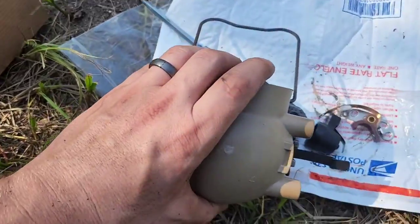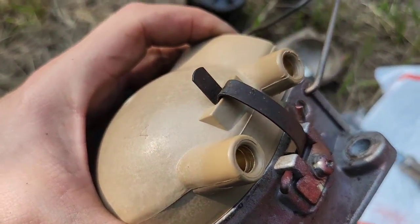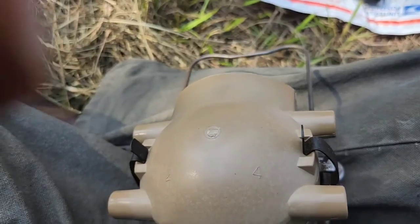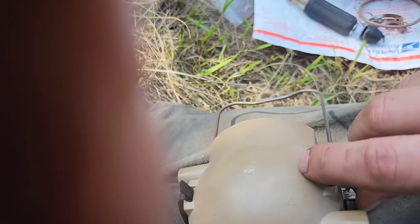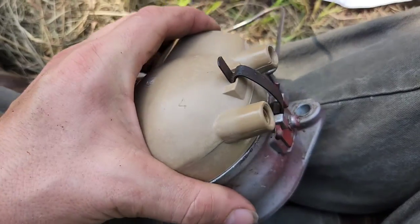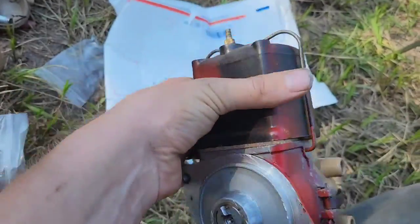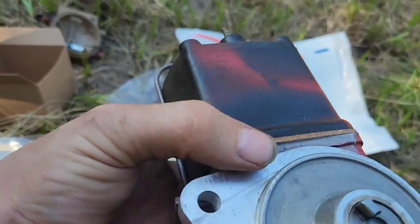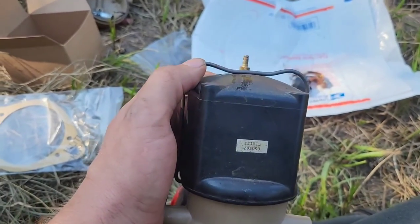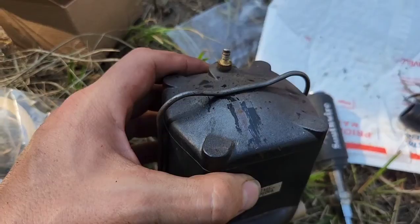I may have to use two hands for this. Press the thumb on this side, the other thumb right here in the middle — it springs it a little, opens it up some, and lets you slide right on. Got the cork gasket in there. It does make it extra tight to get up on there, so you do have to use two hands and kind of rest it down on the belly. But it's up and it's nice and tight.